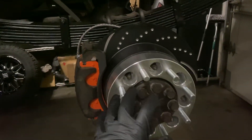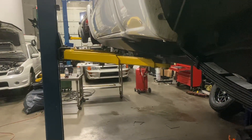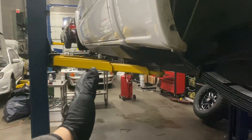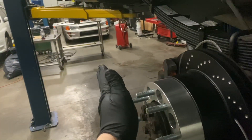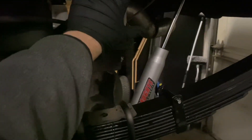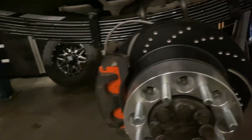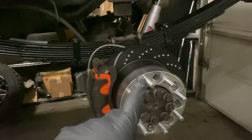Got everything buttoned up — one more surprise. We've got these two-inch billet aluminum wheel spacers. On these Chevys when you lift them the knuckle geometry pushes the front tires out, so the rear tires sit in further and it doesn't look good. These spacers correct that so the front and rear tires are even side to side. Got the new Deaver six-inch leaf springs in, the stainless braided brake lines on — everything's looking really awesome. In a future video I'll be adding airbags in the rear to replace these bump stops with an onboard air compressor.